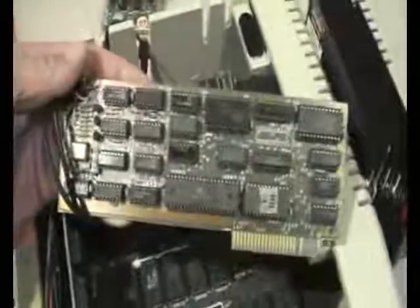This is an 80-column card, so an extra graphics card. This is the language card, which mapped another 64k of memory alongside the built-in 64k. You could toggle between the two 64k blocks of memory — 64k being the maximum that the 6502 can address.